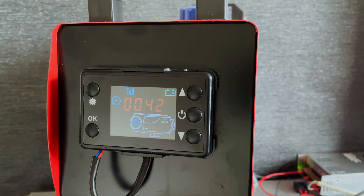Hi everybody, we're back with another very quick tutorial on this controller. Today we're going to cover a change from 12 volt to 24 volt, or 24 volt to 12 volt. Sometimes they come set to the wrong voltage because they can be supplied with either 24 volt heaters or 12 volt heaters. If you're getting a zero-one error code and you know you've got enough volts, that might be because it's set to 24 volts.